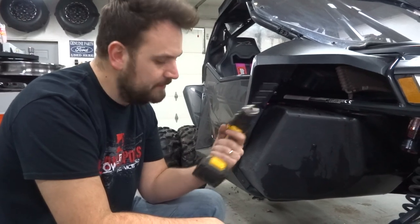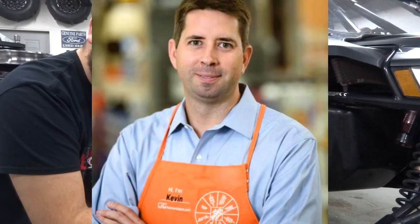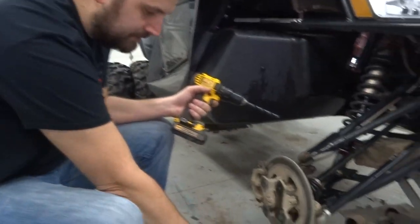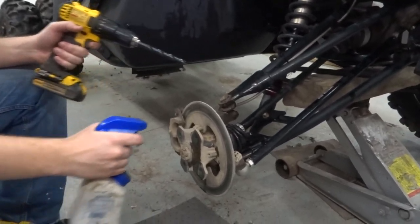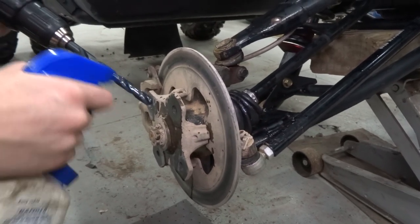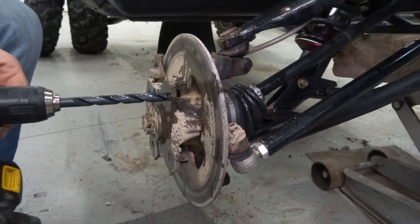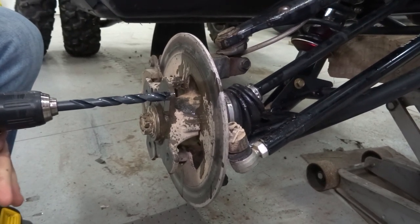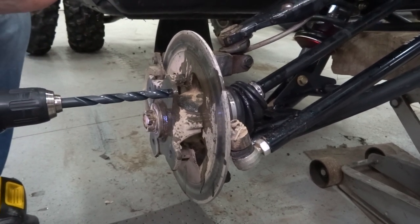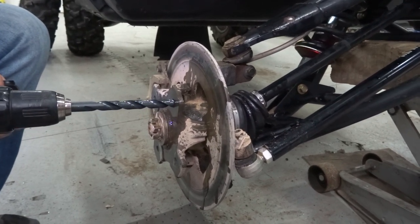Here's the provided drill bit. This is Doug's beautiful sponsored DeWalt. We're going to use a little bit of WD-40. Here is the hole we're going to drill out. We're going to use not a lot of speed and try to hit it pretty square. You really got to hold the drill like a boss in a situation like this. A little pre-spin before you go into it. We'll hit it with some power.